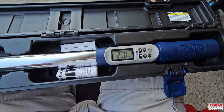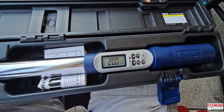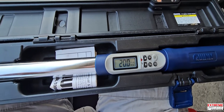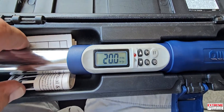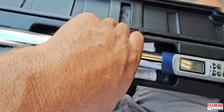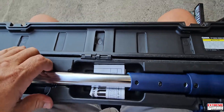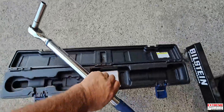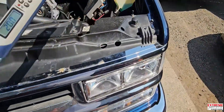Something else we're going to do here is - we've taken note that the crankshaft took a bit to try and rotate. Now that the engine is no longer having anything else as far as rotating assemblies, we're going to set this up. I got it at 20 foot pound right here, and we're going to go over there and rotate the crankshaft, and we're going to try and do this one-handed.